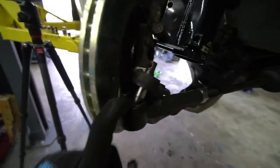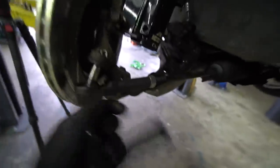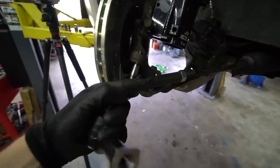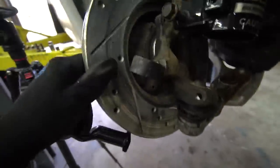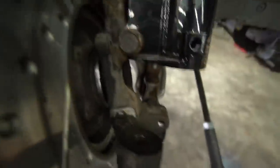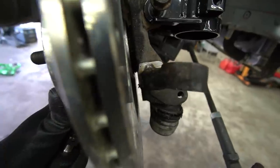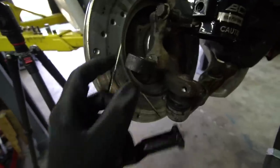I think what we're going to do, since I already have these in here — it'll make life easier if I do sphericals, because sphericals are going to be a straight heim with a spherical end and they're not going to have the kick that this does. What I think I'm going to do is cut this even shorter, keep it angled back — because the reason for the angle back is to prevent the tie rod from hitting the rotor, so that's important — but cut it shorter, keep it kicked back the same amount, and then rotate it flat. Let's try that.